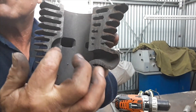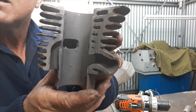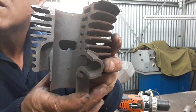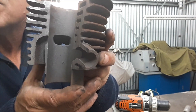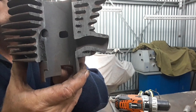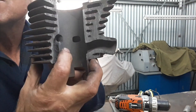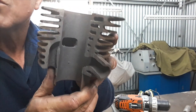That's our transfer port through there and that's our inlet track through there. So that's the profile of a Bantam transfer port - and that's your inlet track. Over the other side here you can see your opposite transfer port and your exhaust port.